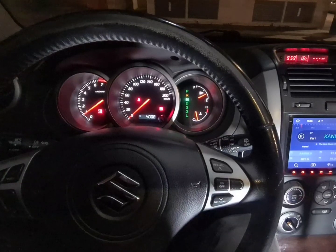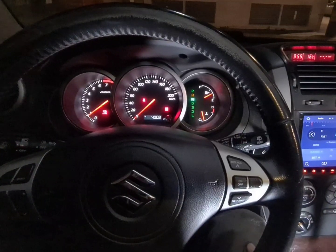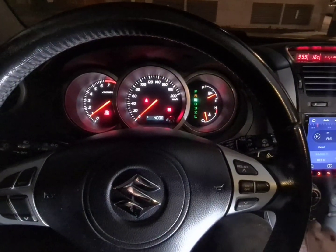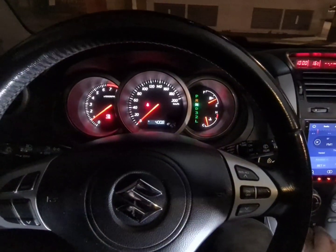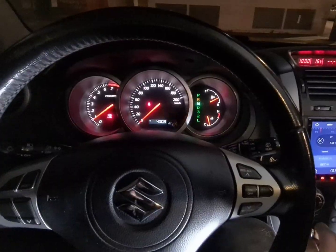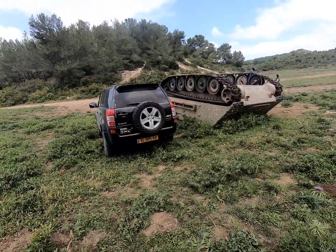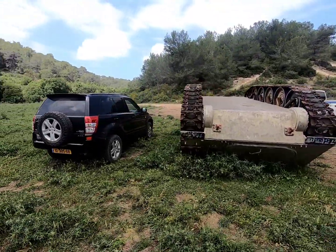Boom, we're in business — the actuator moved to the right position. When I depress the brake pedal I can hear the gears engaging neutral. Now I'm moving it back to 4H position — everything is fine. I'll test the 4L position, which also works, and the 4L lock is also functional. This car was running smooth, switching between the 4L and 4H positions in this beautiful place. Don't forget to give me a thumbs up, subscribe, and share — thanks for watching!